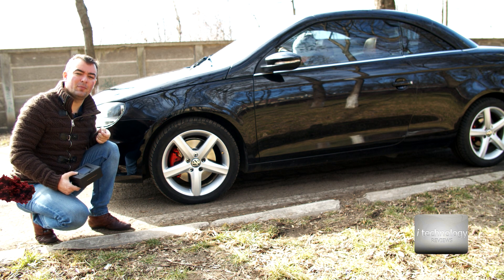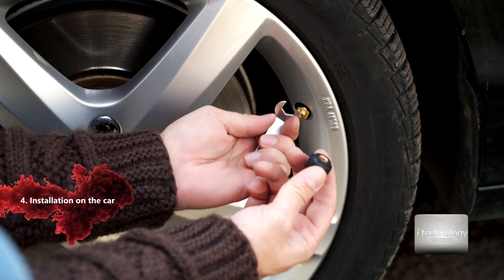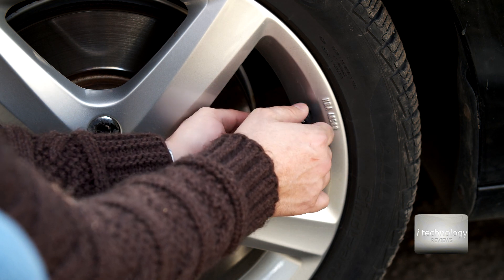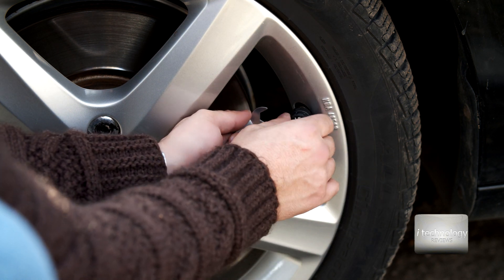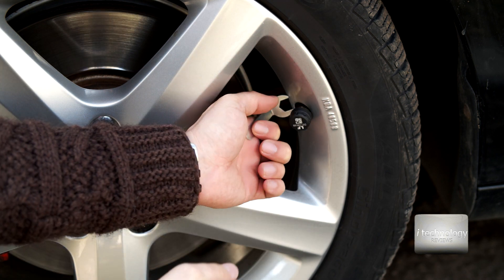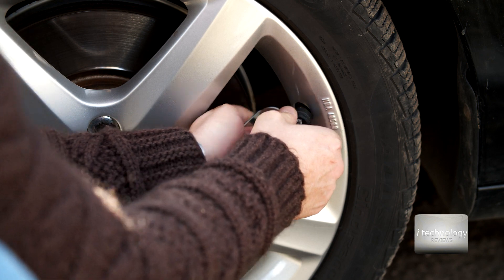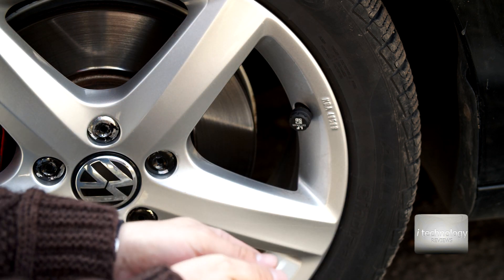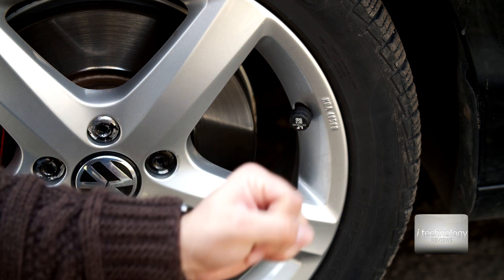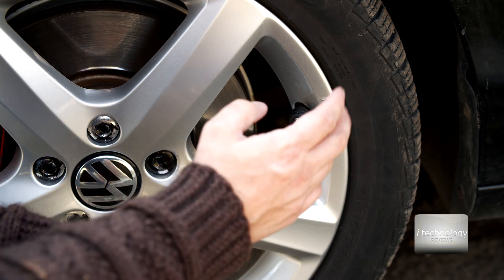Remove the existing hex nut and use the included key to tighten the sensor clockwise. Do not use too much force — you'll hear some air, but that's normal. Tighten it as much as you can by hand, then tighten the hex nut in the back just a little bit so it won't get stolen. With bare hands, you cannot unscrew this pressure sensor. This is the left front — it doesn't look bad at all.